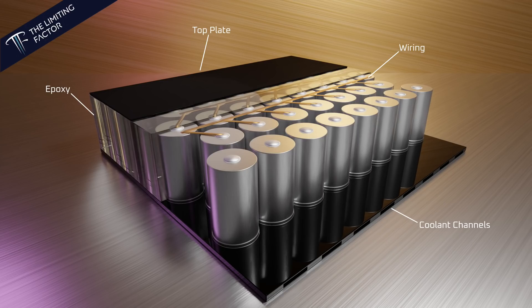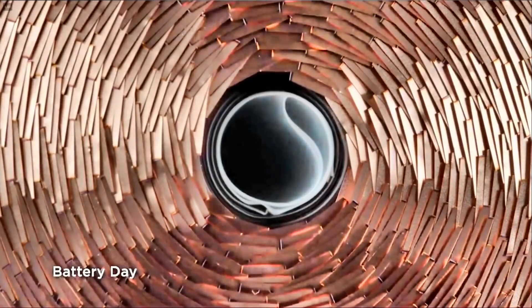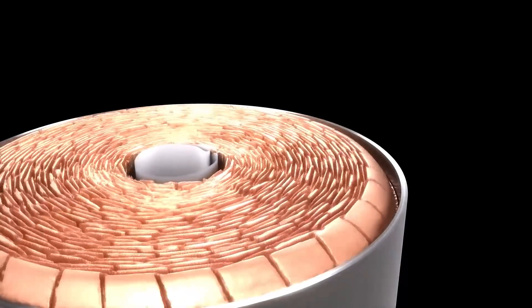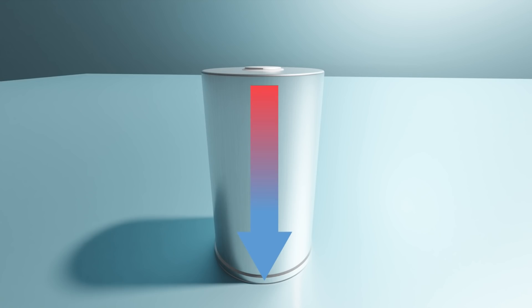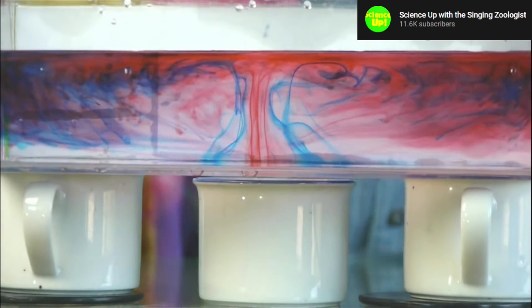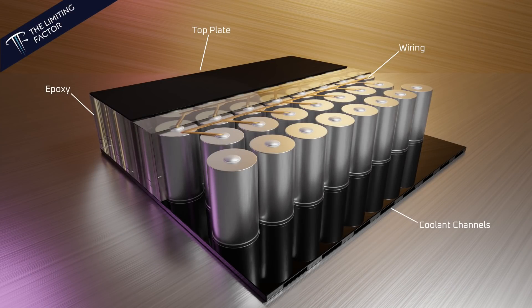As for the liquid cooling at the base, if the cast or stamped-in-place coolant lines are punctured, the vehicle could continue to operate relatively normally. More importantly, if this leak by Electrek is correct, the copper current collector is clearly at the bottom of the cell. Copper has superb thermal conductivity, significantly more than aluminium, so it makes sense for the copper to be at the bottom against the cooling plate. Thanks to the tabless electrode, the 4680 has a nice chunk of copper at the base that creates a thermally conductive pathway through the core of the battery cell that acts as a heatsink. Convection doesn't play a role in cooling battery cells because they're solid objects — solid objects don't allow for the convection currents that liquids and gases do — so it doesn't matter if the cooling plate is on top or on the bottom. Water at the very bottom of the vehicle might also lower the centre of gravity, which is good for handling.